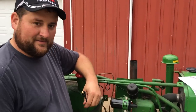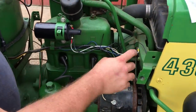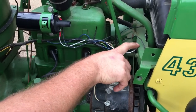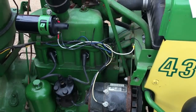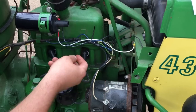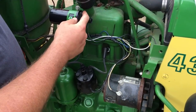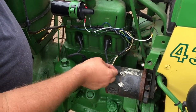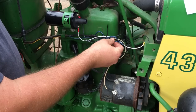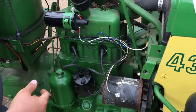We've made good progress on the wiring. Per the instructions, something very different from the original wiring: we're actually grounding the positive side of the coil to the chassis — we chose the radiator support sheet metal. Use emery cloth to shine up the metal and ensure a good connection. The wire with the white stripe coming out of the ignition module connects to the negative post on the coil. To provide power, the solid black wire is spliced into the ignition wire from our wiring harness that used to go to the negative post on the coil.